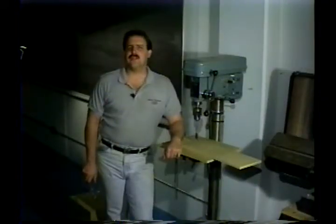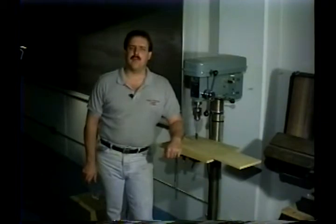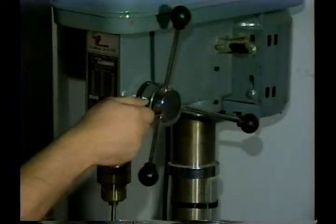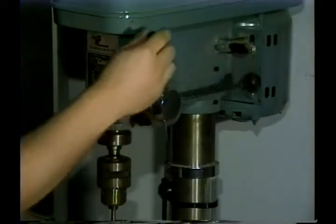The drill press has a variety of different uses in the install bay. One of my favorite uses is that of a countersink for buttons when I'm vinyl wrapping door panels. The purpose for countersinking the buttons is to flush them out with the surface of your panel. So it is important to set your depth gauge properly.